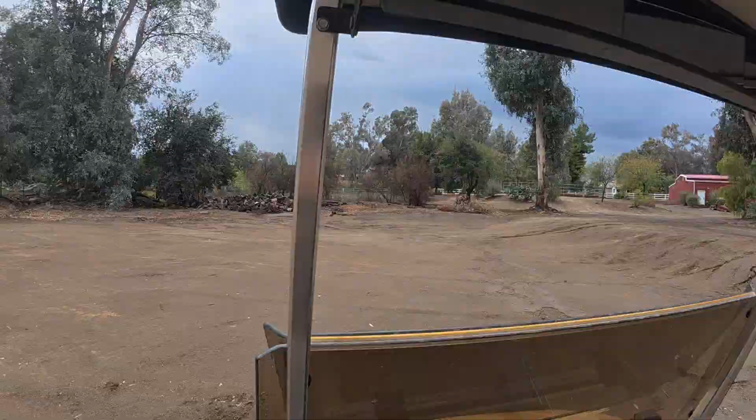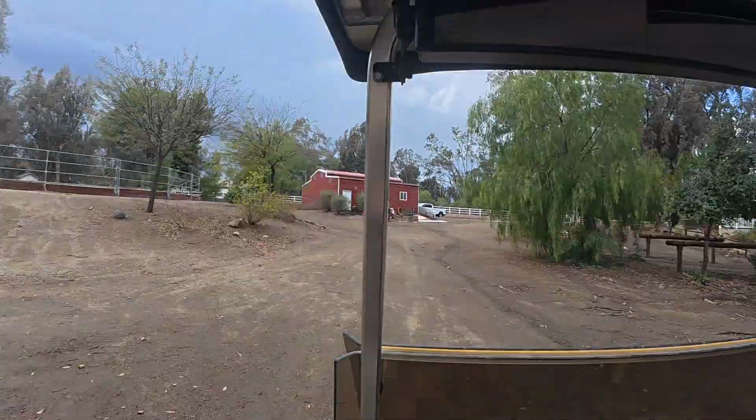Here we're about to run out of footage, but I'm going to keep telling you what I'm telling you. I'll stretch it out. These batteries are worth the investment. They don't cost that much. They work great, and they're super simple to install. Really just remove your old one, put in the new one, bolt it down, strap it down, put up the charger cable, and you are set.